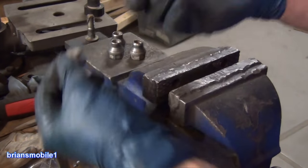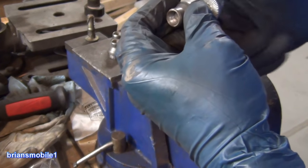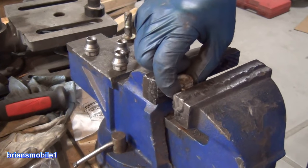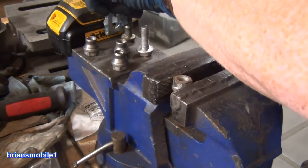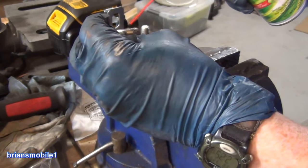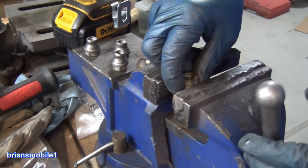Where's the special sauce? Let me show you a before. Here is just a normal bolt in good shape — we'll spin it down. This one's pretty buggered up at the end of it. Should be able to spin it through by hand. You get to here and it's starting to chew it up — and now it's not working at all, just buggered. So if I keep going it'll chew up the threads on the bolt. This stuff's really light — it's not cutting oil per se, but it is just a really good lubricant. I'm just going to slap some of this foam into the groove. Ta-da! I'm telling you, this ain't so hard.